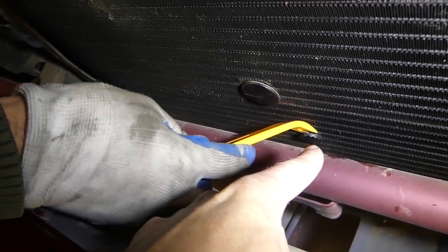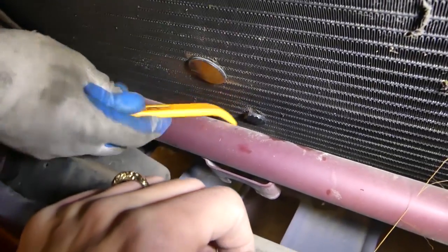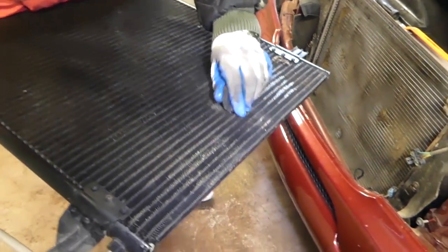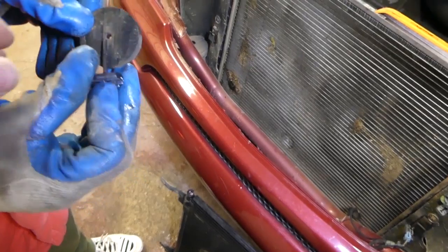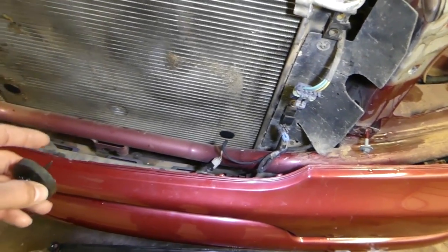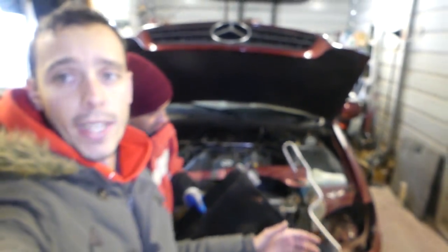Good thing we just saw that — there is a plastic piece here holding. We need to remove it somehow; we've never seen one like that before. You can see it goes through here and holds both the radiator and condenser together so they don't vibrate. It just came loose. Make sure you don't wiggle too much up and down. You can see it just comes out when you pull it like that — there are a couple more here. Make sure it's contacting both radiators so they're not vibrating. That's the condenser right here — we got it out.